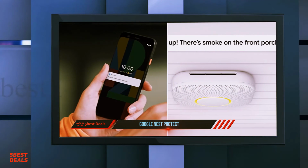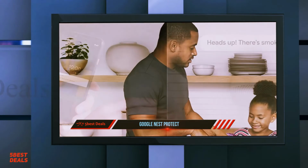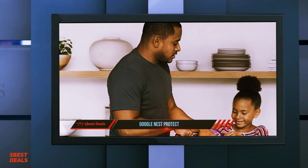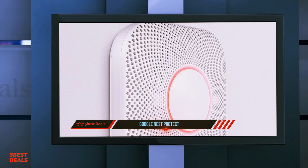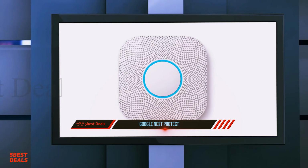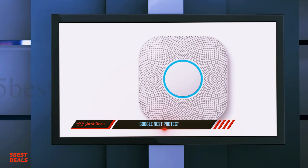Little screw, no screw icons on the hard plastic make it easy to put the right side facing outward. Simply place the plate in the desired position and mark spots for the 4 included mounting screws with a pencil. At 1.65 pounds, the device isn't heavy. We were able to drill narrow holes in the ceiling, and then screw the back plate into the drywall without needing anchors. Mounting the device on the plate is also simple.